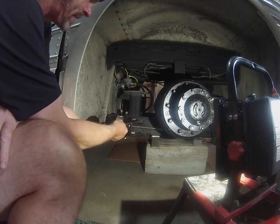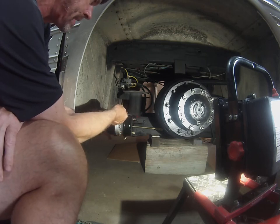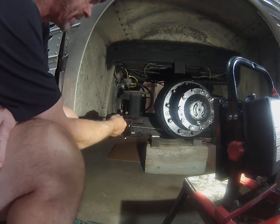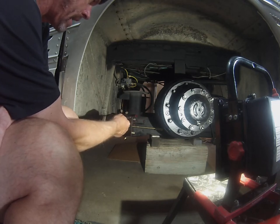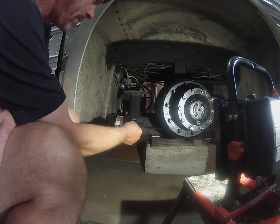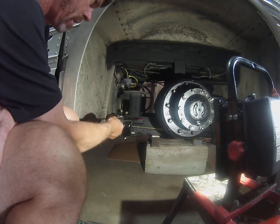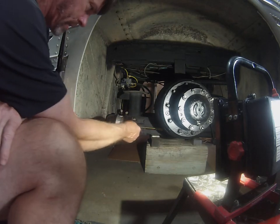So that's what it takes in terms of fabrication — you need to fabricate a bracket and the stud plate that goes in there. The can has to be bolted onto the bracket first, put the bracket in place, and yeah it's a little bit of messing around. But once it's on here, you need to figure your dimensions: this rod needs to be nice and level and straight in its traveling position. You don't want this rod tipping up or down, or at an angle in and out. You have to do a little bit of measuring on where your slack adjuster is to make sure this rod stays nice and straight.